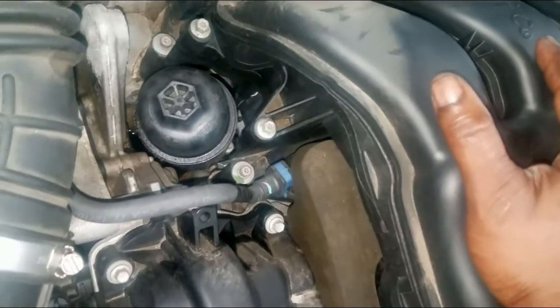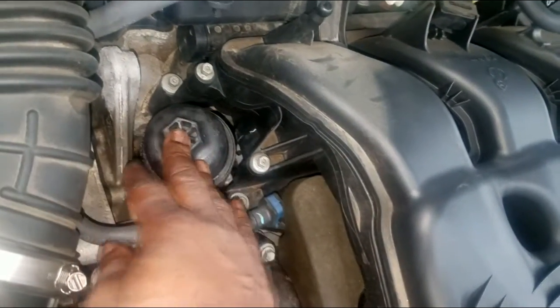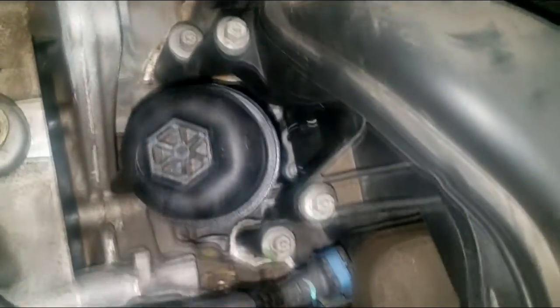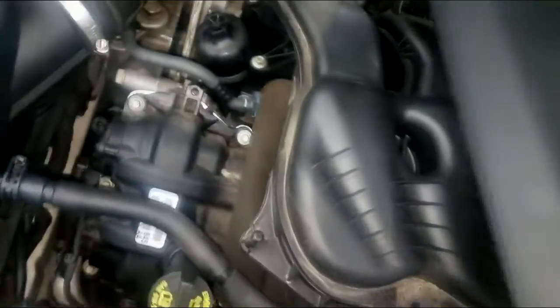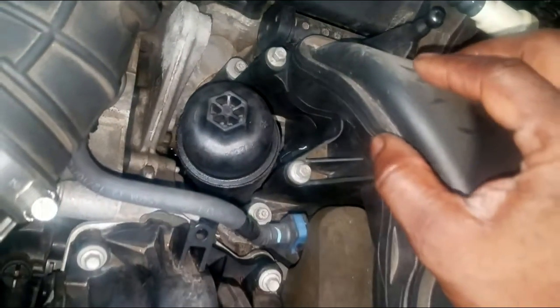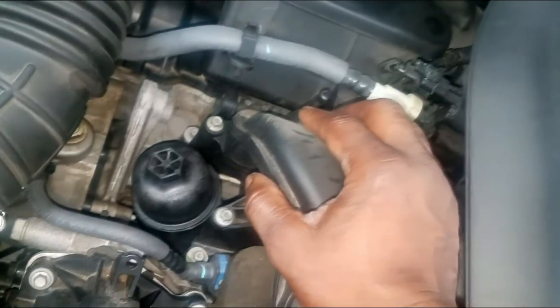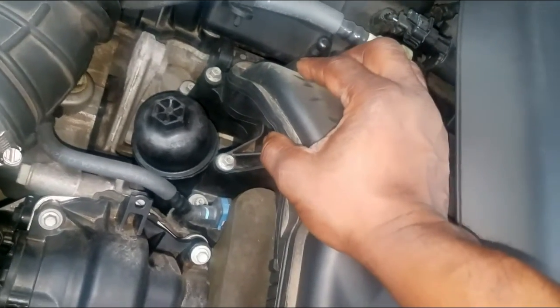You're gonna come with a coolant temp sensor, or a coolant sensor, and an oil temperature switch sensor. All right, so instead of taking all this off just to replace that sensor, when you can obviously see the oil filter adapter housing is leaking, you see oil all down in there. You can take a look on this side too, probably, but I haven't made it down this part yet. Now, y'all gotta also be careful, because when you're changing the oil, some people can waste oil down in there, but at 75,000 miles, it's likely leaking. So, based off previous experience and monitoring the miles of when they fail. But once you do them, you're pretty much done, because they redesigned them and they're a lot stronger and tighter now.